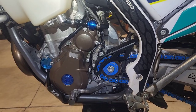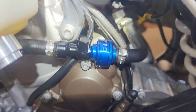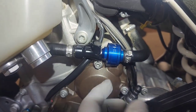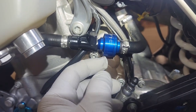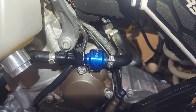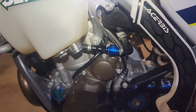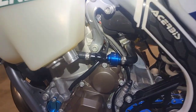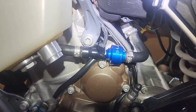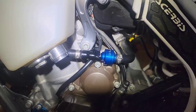Okay, there it is, all installed. Looks good. Best of all, it's something you could service on the trail if you had to — if you for some reason got that plugged. This just snapped right in there. And now to service it, you just disconnect that, unscrew the filter body off, and just blow out that filter or use solvent. I'm happy with that. I think it's worth the upgrade. They're not cheap — they're around $65 — but it is something you could service on the trail if that happened to get plugged. And it looks nice. It's a nice quality part.